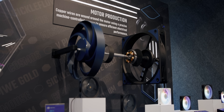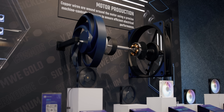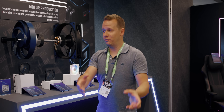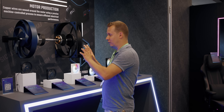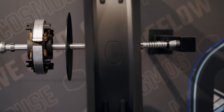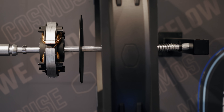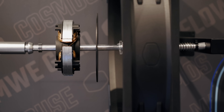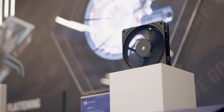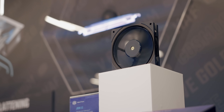Let me explain this with the fans already out in the market. I know this has already been released, but it points towards the progression between the engineering on their ODM side cascading down into the consumer side. Things like a double reflow bearing, the airflow channels they've created for this fan, and a bunch of other technology have made the Mobius probably one of the best performing fans in the last couple of years — all coming from that expertise.